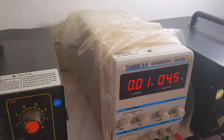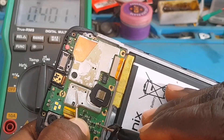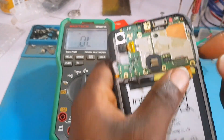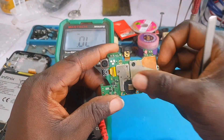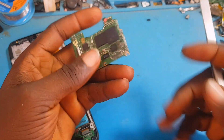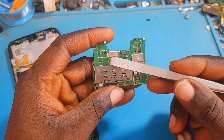The first thing we are going to do is put our multimeter on diode or continuity mode — red probe on ground and black probe to take readings. First, taking a reading from the VBAT: the positive and negative are both reading properly. I'm going to remove the PCB from the chassis of the phone. I'll remove the PCB now and do a physical inspection, but first I have to remove the shield. The shield is out. Now we put our multimeter on diode mode and take readings of all the components to see if there are any shorting components.